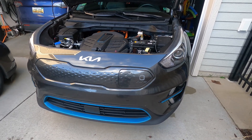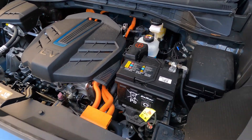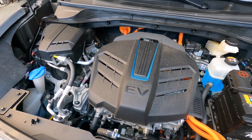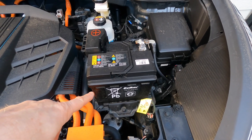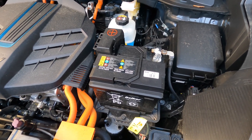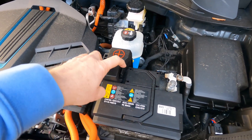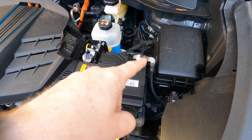This is my 2022 Kia Niro EV. You can always tell the EV version by the charge flap in the front. As you can see, we have all these things under the hood — almost looks like a conventional vehicle, except you do see all these orange cables, which are the high-voltage cables. We have air conditioning compressors, wiper fluid. But we also have a 12-volt battery, and it's a good idea to check this every now and then because it's still a lead-acid battery, which means it has probably about the same failure rate as a normal ICE car starter battery. We have our negative terminal and a positive terminal, which is protected underneath a little cap so that we don't get any shorts.